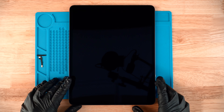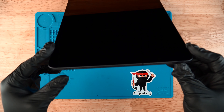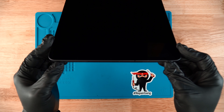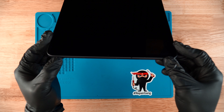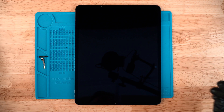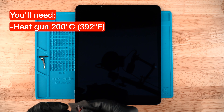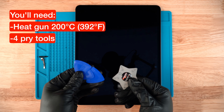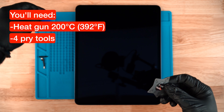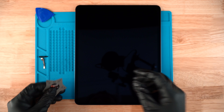For this specific iPad we're replacing the power button. If you look right here where the power button should be sticking out, it is sunk in and there's no way of turning this iPad on. For this repair you're gonna need a heat gun — I'm running it at 200 degrees Celsius — and you're gonna need four pry tools. We have these available on our website, links in the description.